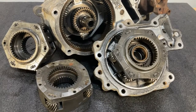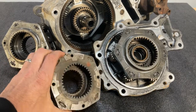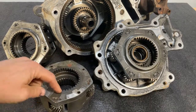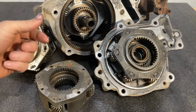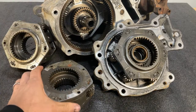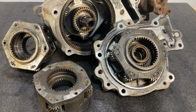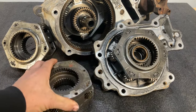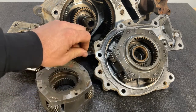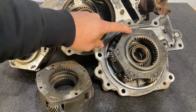As you get into the case and look at your planetary gear, one important thing to point out is that the gears from a 1350 model Borg-Warner are going to look really similar to the gears of a 1354. There's a couple subtle differences, and every now and then we'll get a customer trying to put a 1350 gear set into their 1354 model Strongbox, and they can't do it because this isn't the right gear, but they look really similar. So one thing to look for, 1354 is going to have 6 pinion gears.